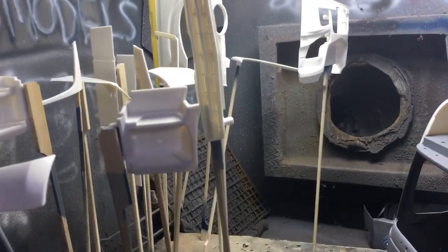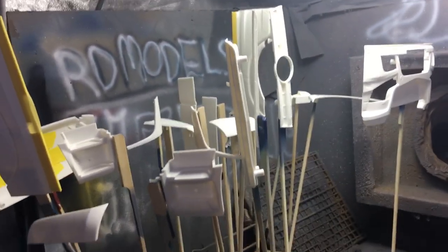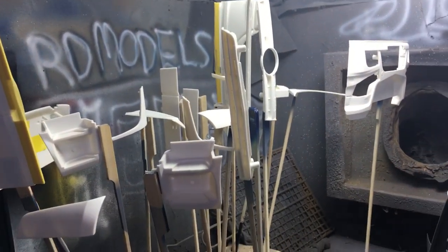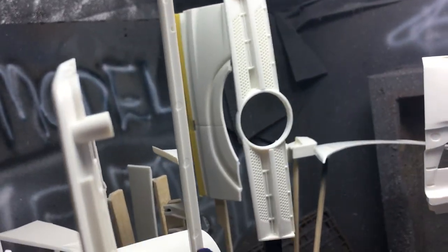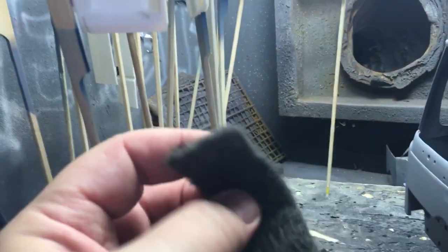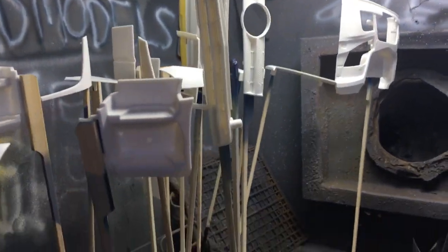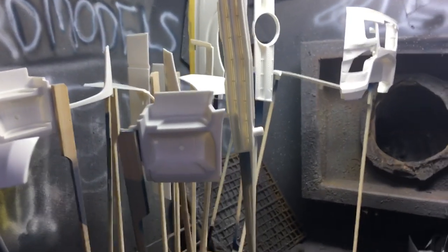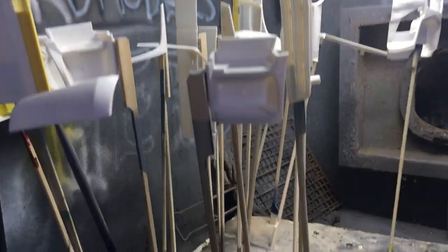All the parts are already prepared. I've flattened everything down using 2000 wet and dry, sanded everything down wet. Anything I couldn't sand down, like the front grille and bits and bobs like that, I used what's called a scotch pad - it's just like a rough sanding material. I've then washed everything with fairy liquid, cleaned it all up, dried everything, and attached everything to the skewers.